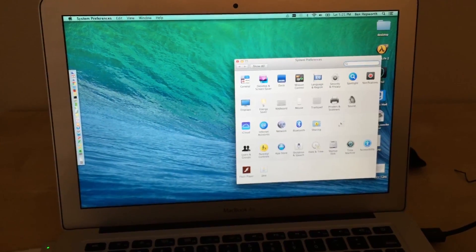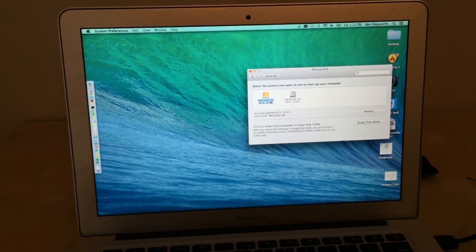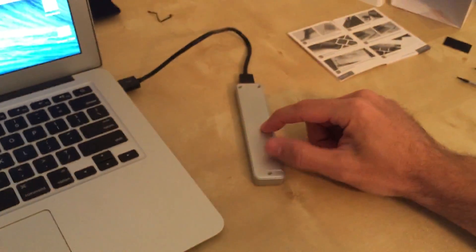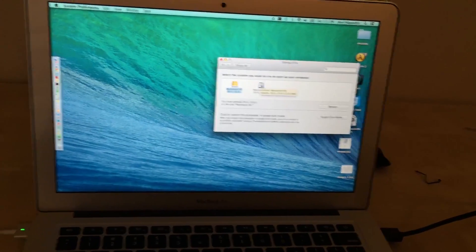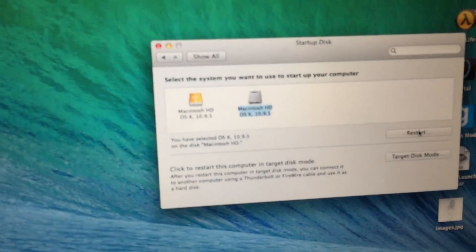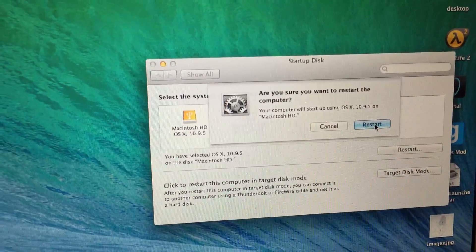Startup Disk — right here. Select the disk you want to start your computer. The reason we needed to have the USB one plugged in is because it actually booted off of this one. It's still named Macintosh HD. What you can see is external now. We want to select the internal one that has a hard drive picture. Select that one to be the one to start up your computer, and now we're going to hit restart. Notice it's named the same thing — we just cloned it, so it's still called Macintosh HD.